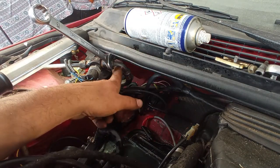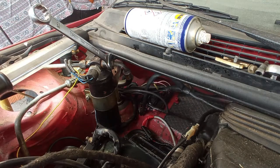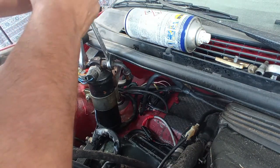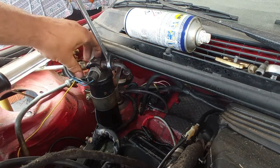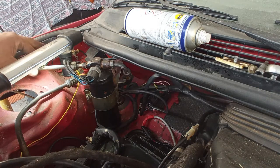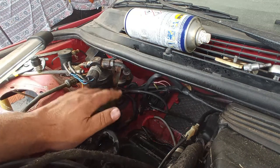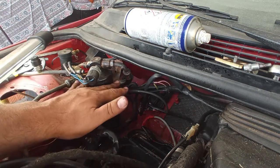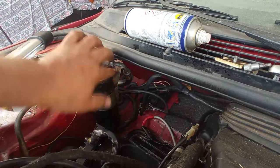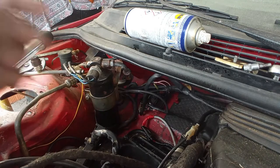Maybe I can take this all out and take out the pipes on the bench. Or something like this. Let's try like this. One of them will give up, so I think it is the best choice to really take everything out. And the O-ring is over there on the inside. Because the dryer over here will be a new one, I do not care about that. I just can hold it with a vise on the bench, and just take out here the pipe. I do not want to bend anything over here or risk bending here also the structure of the car.